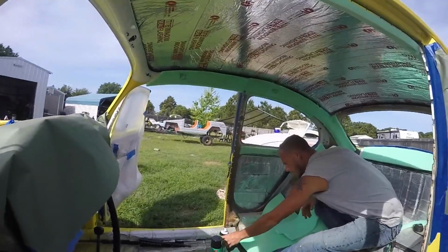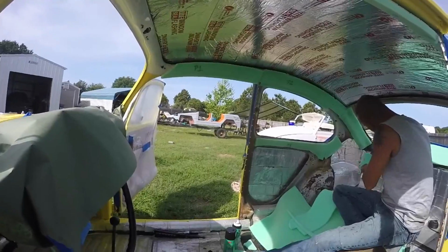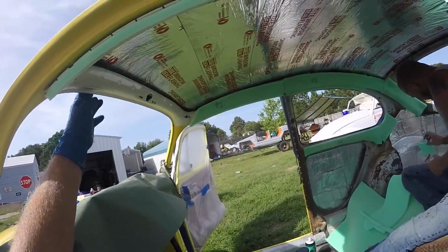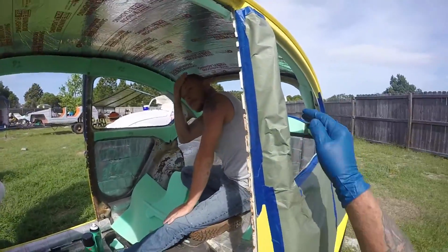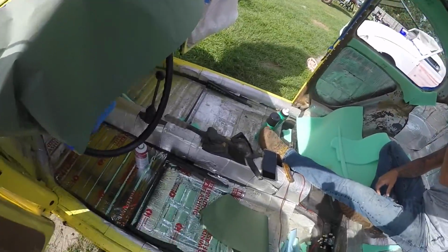I'll demonstrate it as one person doing it. You can do this by one person, putting in the headliner and all the bows and everything, and then you put your clips on the front, get how much material you want, make sure your sail panel is coming down. This area right here is what I call a sail panel. If I get the wrong nomenclature, leave a comment.